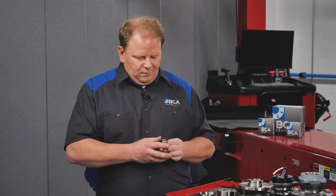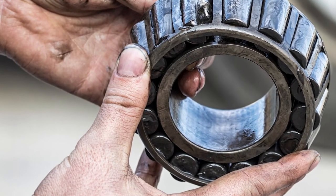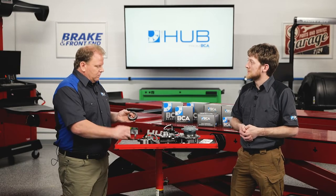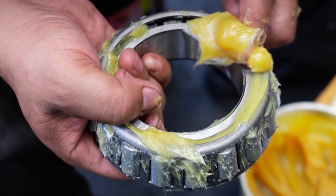All right. As a technician, what should I know going into a job working on this type of bearing? I'd familiarize yourself with the inspection process. If the customer is hearing a noise or growling from the rear axle, you can take it apart and check for looseness, galling, or spalling — any kind of abnormalities in the roller elements and also in the race. So a good visual inspection, a good set of tools, a press, a bearing packer, and knowing that whenever you replace these, you're also going to need to replace a seal with it.